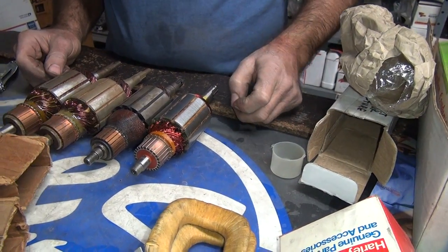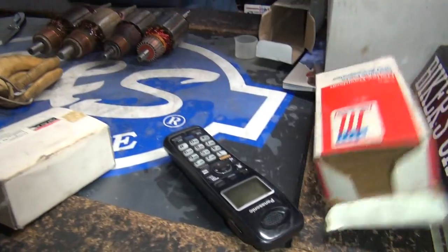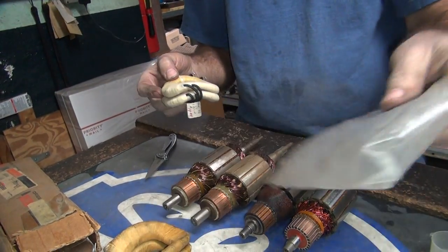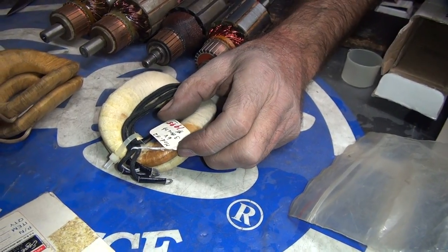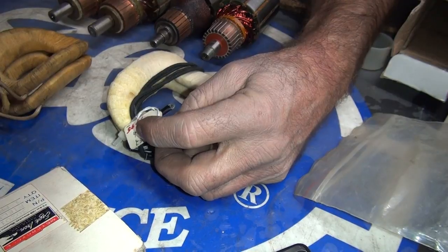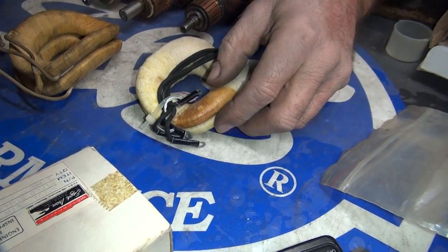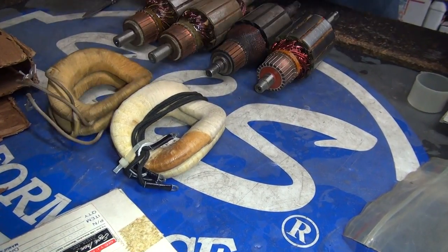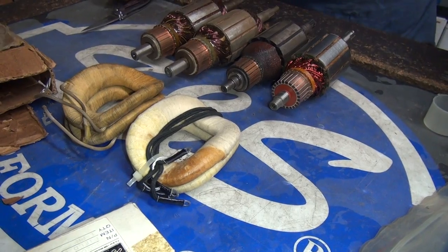You just unwrapped this - this is the one that was on the shelf. So these go with that one. This is labeled 6-volt Model 52, 3-brush - but the only problem is Model 52 is a K model generator, it's actually a 2-brush. I don't care what the hell they marked on the tag. So you go into your parts books and it'll tell you all these different things. Look at the size difference between these and these - big bastards are different.